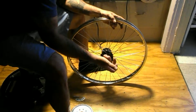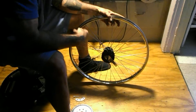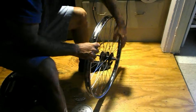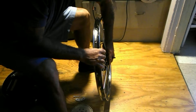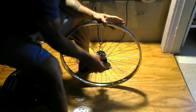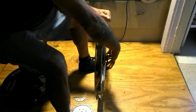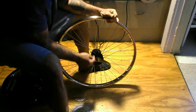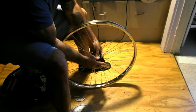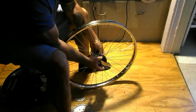The hub adapter bolts the whole thing to the hub so that the hub is actually driving the wheel instead of the spokes — that seems like a better way to go. I'm saving up the money to buy this right now, and once I get it attached I'll make another video. Most of the time these wheels fail because you don't keep proper maintenance on the rag joint right here. It leads to inner wobble because it's too loose, out of alignment, or slipped — because the bolts travel through the holes in the spoke triangles, there's a limited amount of give and flex.